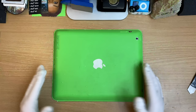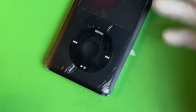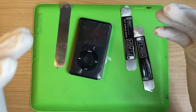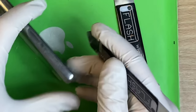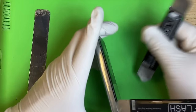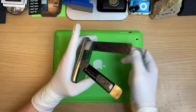Finally, the most common and hardest to open iPod — the 6th/7th generation. This one I found at Kashi's — the battery's so sad it doesn't do anything anymore. For this model, you're going to want at least three pry tools. Because it's made of aluminium it doesn't bend and flex back like plastic does — it bends and stays there. These clips are nightmarish to get to. Take a dig at each corner and pick the weakest one. These have spring-loaded tabs inside — push all the way until they go click.